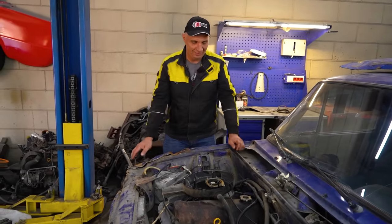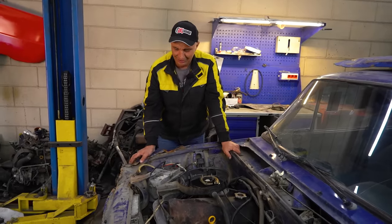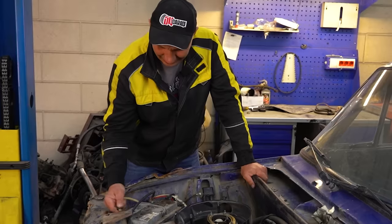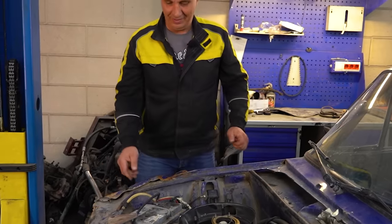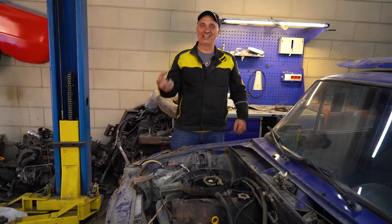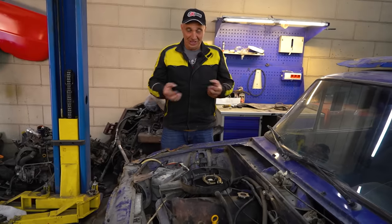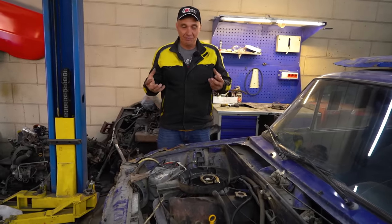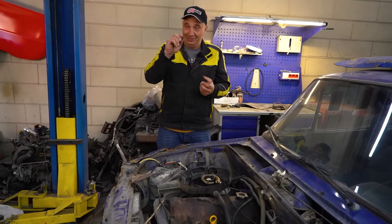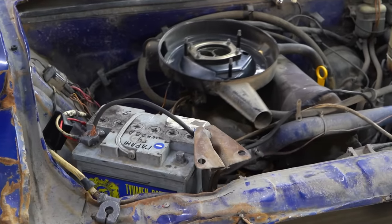Check that out. You can even rev it now. Neat. What if I am... Now that is definitely hot bulb ignition. The plugs have gotten hot and now... The combustion is making the plugs red hot. So the plug's getting hot? And the needle, the tip of the glow plug, simply isn't cooling off. Or maybe the alternator is powering them up.